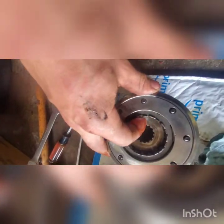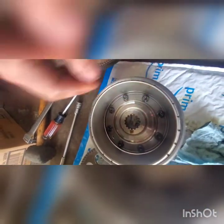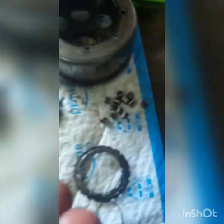Take your shaft off here. I do see some wear on the sleeve part of it, but all I've got coming is a sprag clutch. It's an updated clutch so it's going to cover that extra little worn spot and it'll all be full contact area, not just the smaller part. To remove the clutch, get around the back side — you've got bolts all through here, those are eight millimeters, but they're going to be difficult to get on because it's magnetized. The starter clutch has flat-spotted rollers — damaged pile and good pile. The spring goes around all the rollers and you can tell the spring got damaged too.